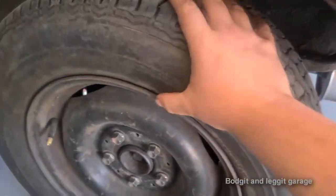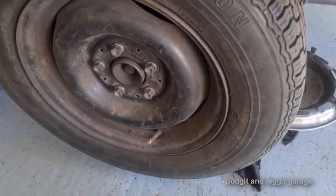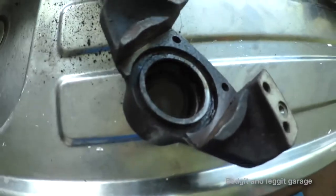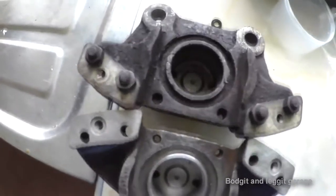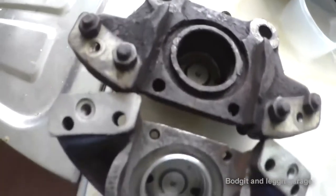I have fixed the customer's problem. You can see in there — the brake line is hanging up, but look: simple seized caliper, take it off and it's not seized at all. Look at all that slime and buildup blocking that port. You can even see it on the other side as well. Half of that was being blocked, so you were never going to get the full pressure. This is the issue when you leave it too long without using it — things just break. That's the one I've cleaned, that's the one I haven't — you can see the massive difference.